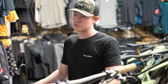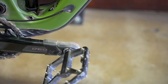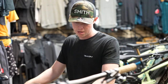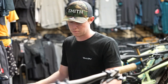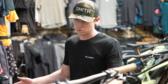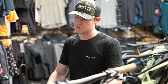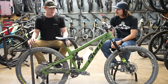Another significant upgrade is putting on some Shimano Deore 170 millimeter cranks. Stock this thing comes with the Race Face Ride 175 millimeters. I'm definitely liking how the shorter cranks ride — it's a worth-it upgrade. In an ideal world I'd be running 165s but those are a little bit tricky to get these days, so I've been really happy with the 170s and how those have felt so far.